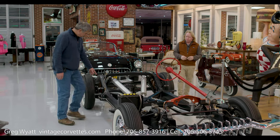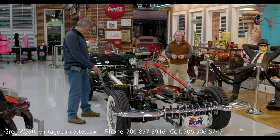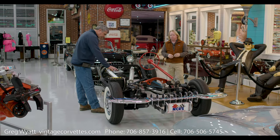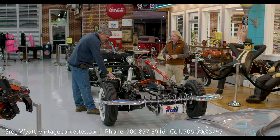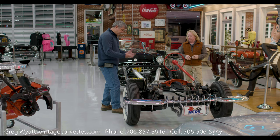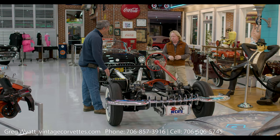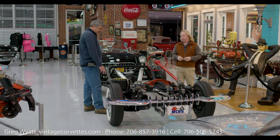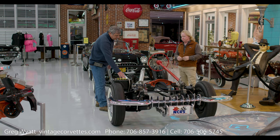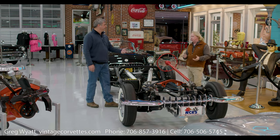You've got the gas line with this spring to protect it, all the way up through the frame, the hardware, the spring. And the battery — we've talked about the battery. In the old days these batteries were filled with tar. Tar top. So they put the plates and then sealed it with tar by just pouring it on top. These batteries can be reproduced with a modern AGM battery inside — a restoration battery that looks correct.